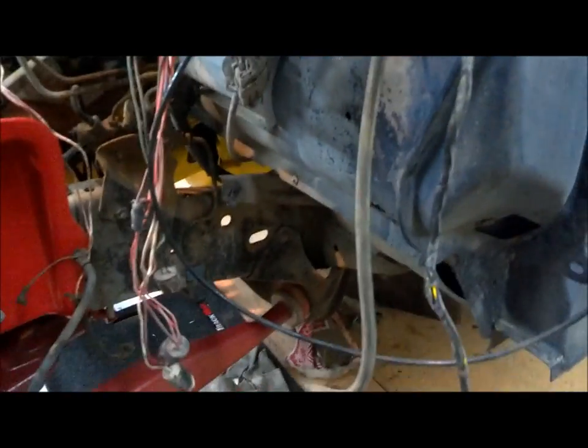I also took out the parking brake. I'm going to put in a center parking brake out of a Jeep Cherokee. The original cable came out from here and down, but with 38-inch tall tires and no lift I need the extra clearance. The center handbrake just makes more room, especially since it's tight with the fender cutting.